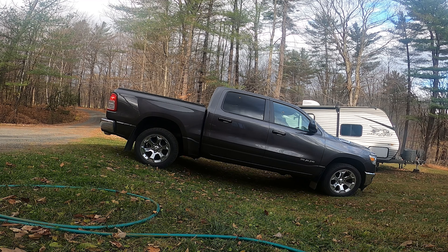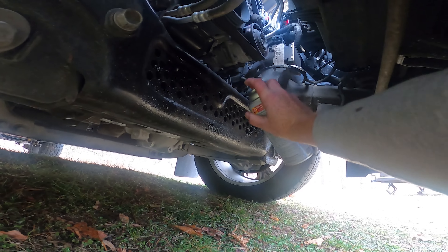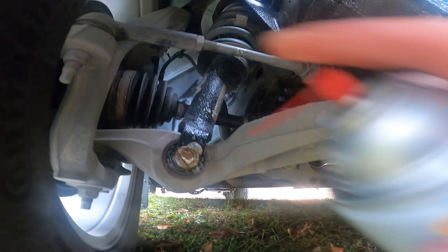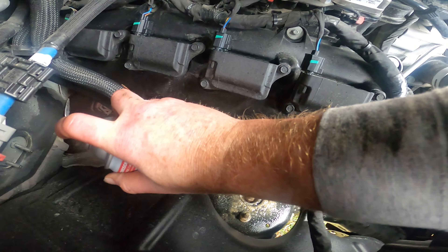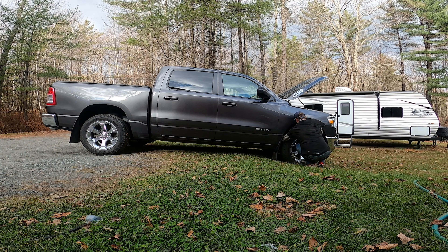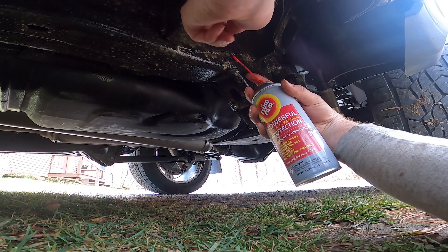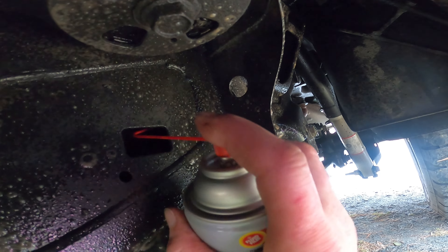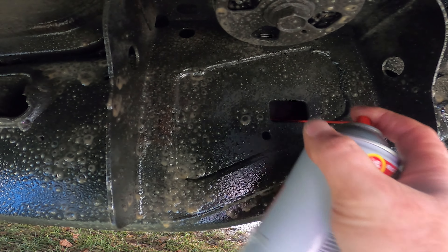When I think I have the back covered pretty well, I move the truck so I can access the steel under the nose. Same thing — spray the painted steel, get multiple angles, and avoid spraying your serpentine belts. Pop the hood and get the top of the strut towers; reach in and spray the top of the frame rails. When I think I have good coverage, I start spraying inside frame holes. I bend the straw to get a good angle and turn it as needed to spray in different directions. I try to spray enough inside the frame rail so it will ooze down and coat the inside bottom of the frame, where most salty grimy stuff will settle and cause internal rust.